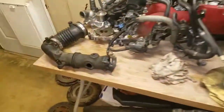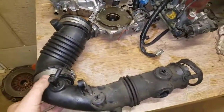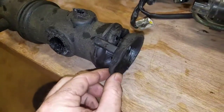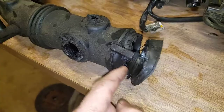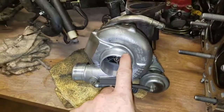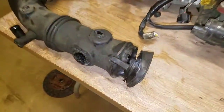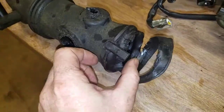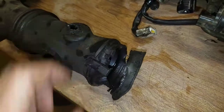What had happened was I had a problem with this turbo inlet tube. You can see here on the end - these things are made out of softer rubber down here on the end where it connects to the turbo. They're just getting to the age where they start to deteriorate and the hose clamp cuts through it.